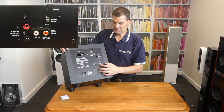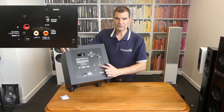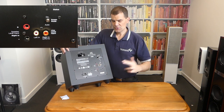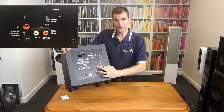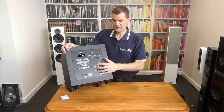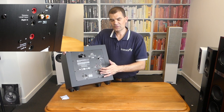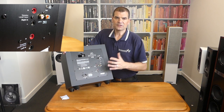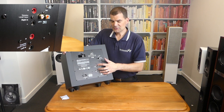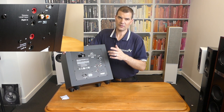Beneath the power mode, we've got a left and right input — one of them, the right one in this instance, is clearly labelled LFE, which should be the LFE output of a home theatre amplifier. Alternatively, you can give it a stereo input from a stereo preamp or the like. Beside it — and unusual at this price — they've also added speaker level input. As people return to stereo setups and want to add fatness and weight to the bass but may not have a pre-out, the ability to tap in at speaker level is an important extra feature, and it's wonderful to see it at this price point.